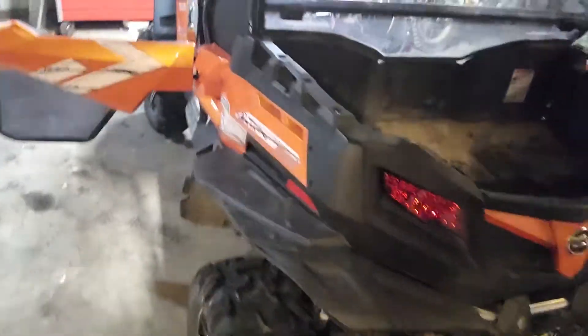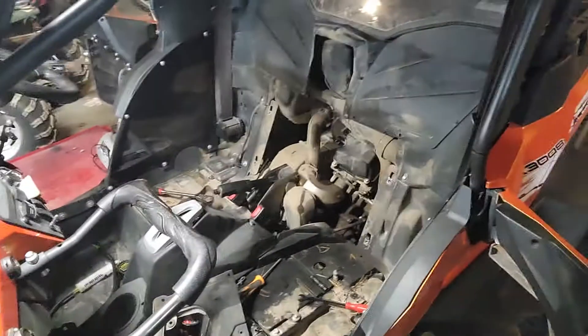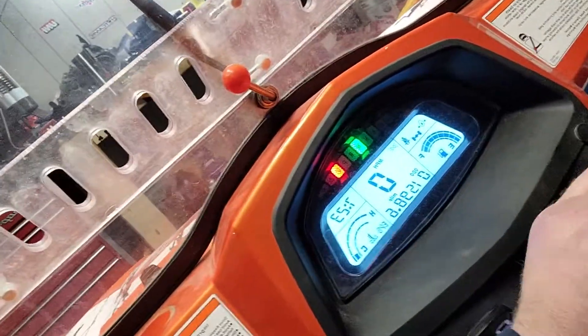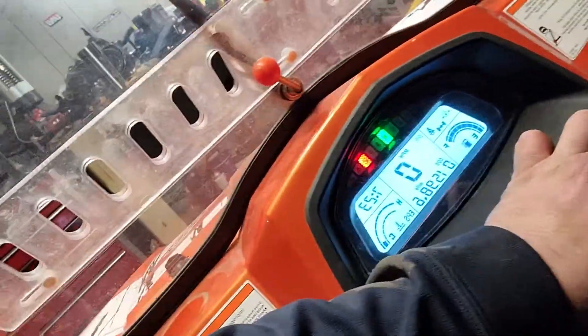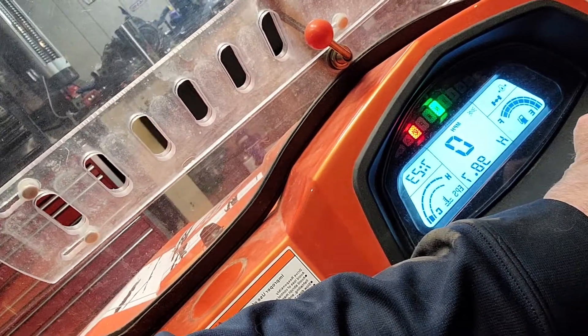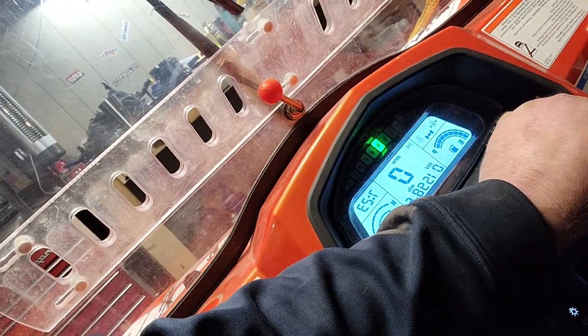So I hope I helped some of you guys. What really gets me is this thing's got 1,598 miles and 98 hours on this machine, and it has low compression — it's not a valve adjustment issue, it's the cylinder rings, piston rings.